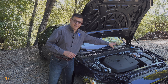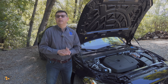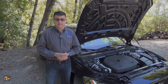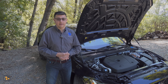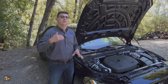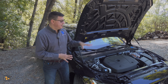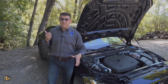This has a front-wheel drive transaxle, an eight-speed automatic by Aisin, and an electric axle in the back. That's also very different than the Hyundai and Kia hybrid systems, which use a mechanical all-wheel drive setup and a traditional six-speed automatic up front. In fact, in terms of theory of operation, this is most similar to the brand new Lexus Hybrid Max system in the Lexus RX — traditional automatic transmission, turbocharged engine, e-all-wheel drive setup in the back.